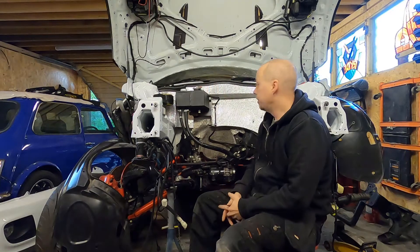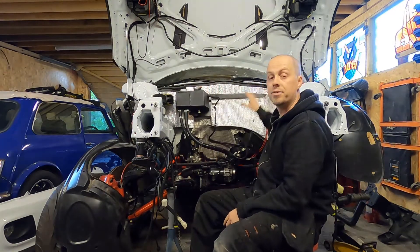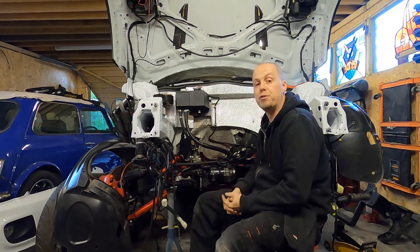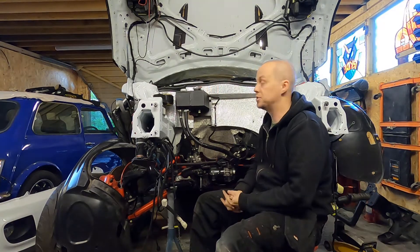One of the main things you'll notice in this engine bay, if you're used to the R53, is that all of the plastic cowling across here has gone. You need to get rid of that — it's too big, it's in the way, and even if you could fit the turbocharger in with it there it wouldn't last long before it either melted or caught fire.